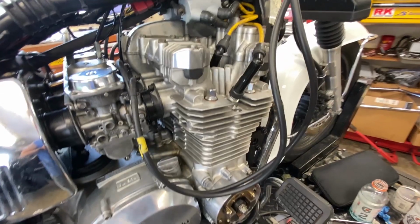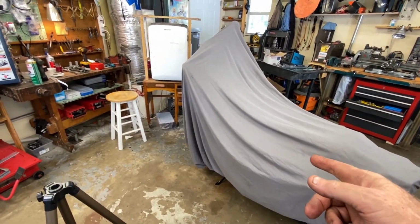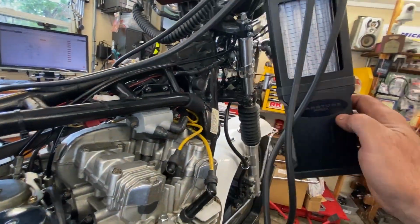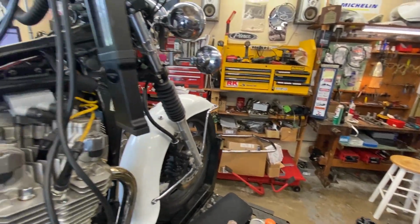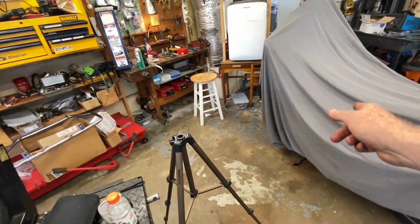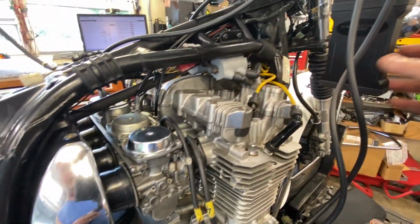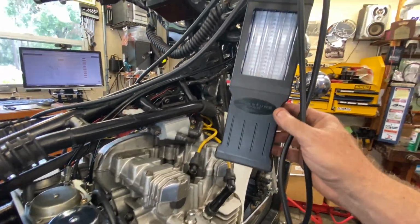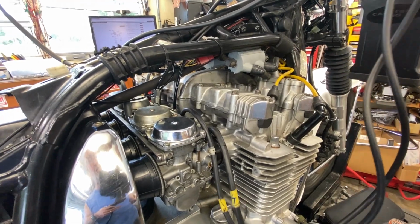All right. So you remember, I don't know if you saw earlier in a Z1R video, I had the same exact scenario where I could not get the carb tune to read on those mechanical round slides at all, at idle. That's a moderately built up motor, all right? I emailed the engine builder and said, hey, I can't get enough vacuum impulse to get this thing to read on a carb tune.